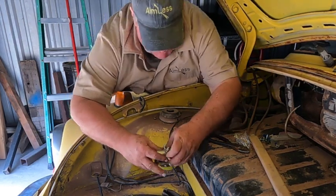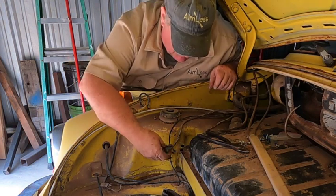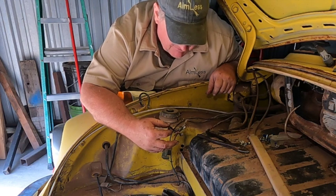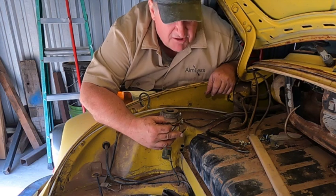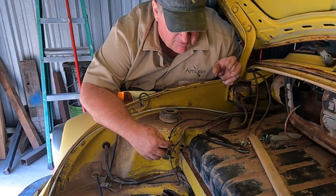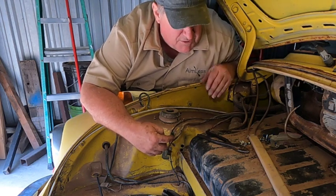What I'm going to do is install a typical firewall-mount relay. Since these wires have already been taped, I don't feel as bad about cutting them and putting crimp ends on them. When I work on something that's unmolested and in original condition, I try my best to find something to go back original. Nothing's worse than a wiring job that's been butchered from one end to the other.